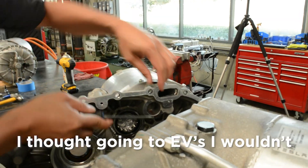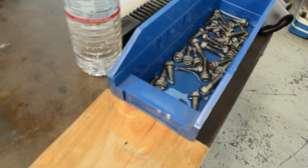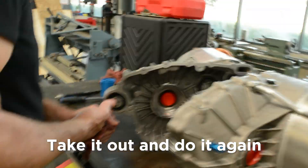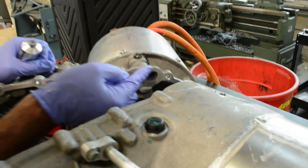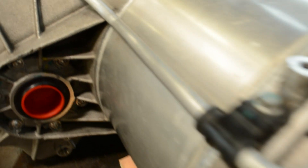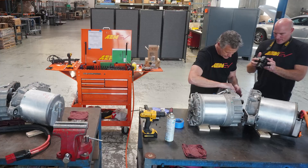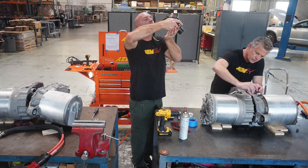Putting silicone on the cases — I thought going to EVs I wouldn't have to do this anymore. Some things never change. The diff just slid in so nicely. This is silicone. These are a couple of water ports, so you go sort of thin right here because you don't want them to — this one in particular is a coolant port that comes over and runs down the side of the diff. It's a really cool little heat exchanger behind this plate over here, and there are restrictors. There's an O-ring on one side and it's just flat on the other side. So I do a real thin layer of silicone around it and just make sure the center remains clear so you don't have to worry about the silicone squeezing into the orifice once she's assembled.